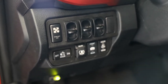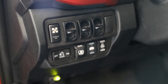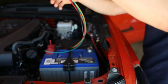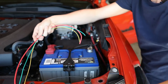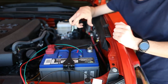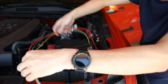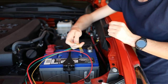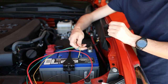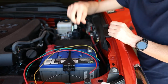I only have to run one wire to the switch itself, and then I ran a second wire that has to go into a power source that comes on with the ignition. Under here we have the wiring harness for the thermostat controller — it's just hanging out under here because I wired in the ground. Since I had to add in the ground for the grill lights I tied them both together. These are the two wires that have to be run inside the cab: one is the ignition power source and the other is the fan switch override. The big red one goes to the fan.